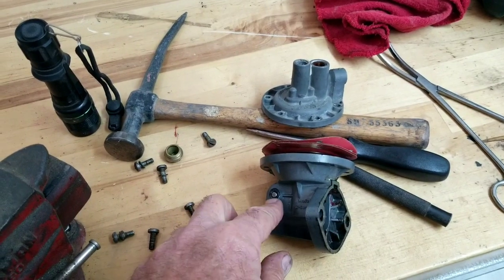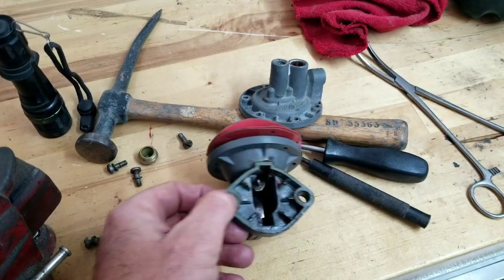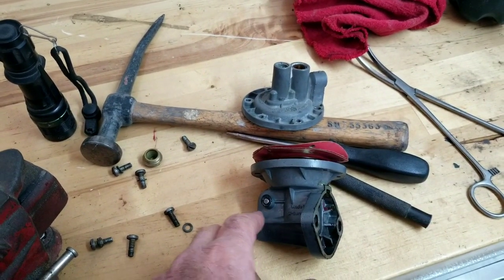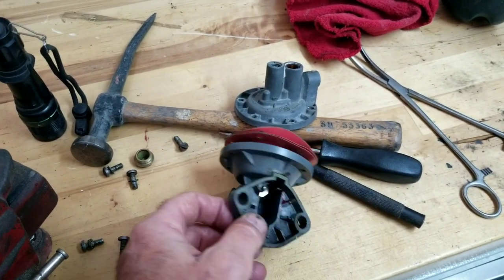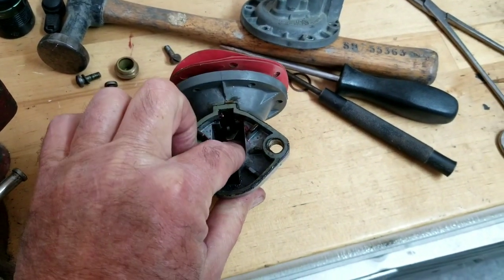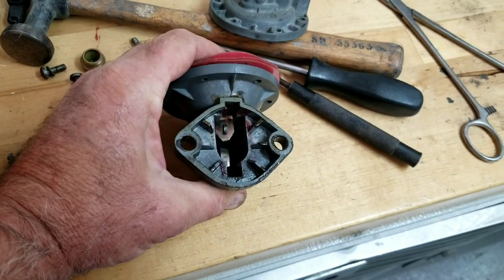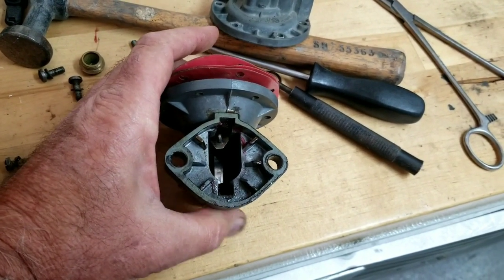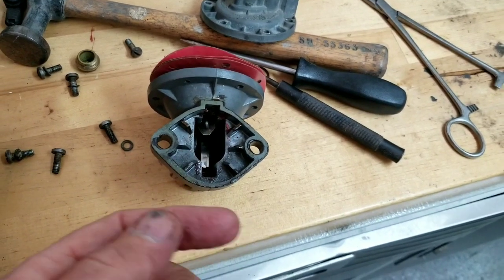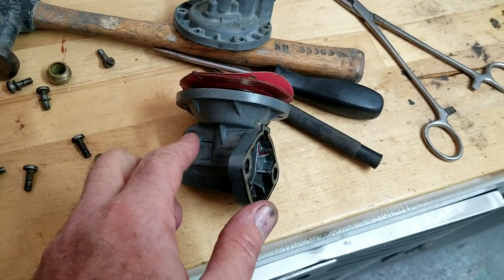If you're going to do this job, I would try and forego pushing this pin in. If you push this in, there are two parts in here that I'll show you later in the video that are very difficult to put back in place. What I would try to do is actually push this down and release with a twisting motion, and take this fuel pump lever that's moving up and down. If you look at your new one, you'll see there's just a plunger - you want to twist that off of this shaft if you can, without having to take the whole pump apart and remove this pin. Do yourself a favor and forego doing that - it'll save you a lot of man hours.